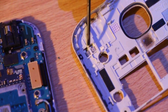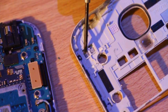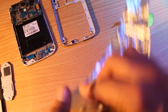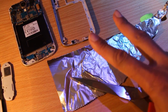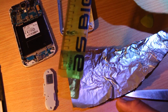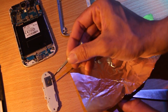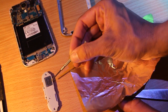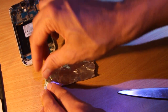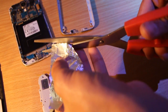The next step is to put two small pieces of aluminium foil, one in each of the square shapes, just to cover the contact pins and improve connectivity onto these two pins. For that you'll need your tin foil and scissors, and we're going to cut two squares. The size is one and a half centimetres by one centimetre. The easiest way is to grab your speaker assembly, as it's approximately that size on the silver part. Just place the foil over the connector, rub your finger over it to get a template, and cut it to size.